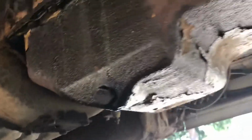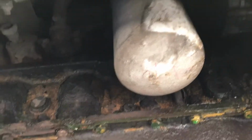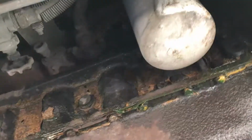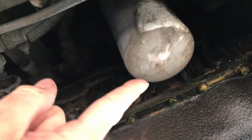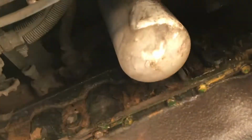All right, from the plug over here, right up there, is your oil filter. It's huge, and it's a really large oil filter. So what I like to do, obviously, is move my pan underneath it. What I like to do, instead of pulling it out, I like to put a hole in it first. Because man, it holds a lot of oil. And if you try to take it off, it's gonna fall down into your pan and splash. It makes a mess. So I put a hole in the bottom using a nail and a hammer, let it flow down into there, and then I pull out the filter.